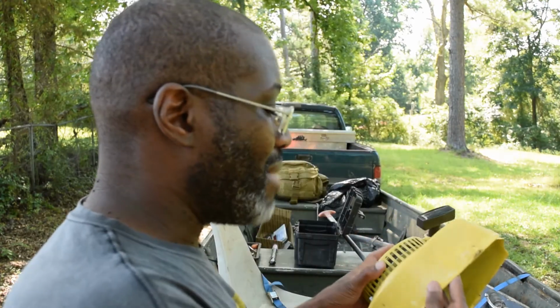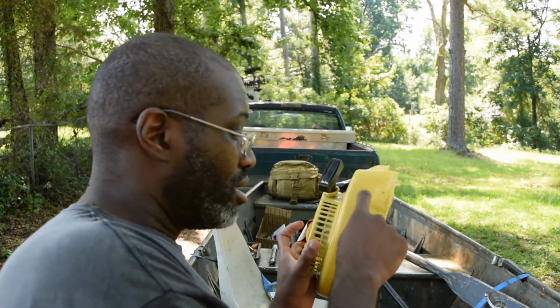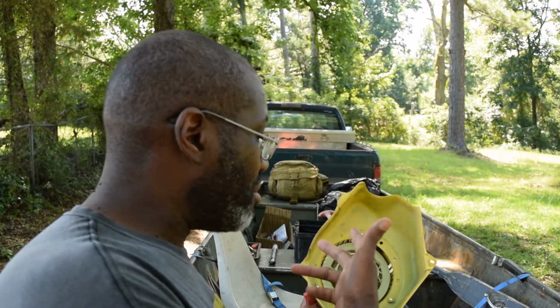If you're one of these guys you got your Predator and you're happy with it, your Predator 212 or your 420, and you're like, yeah, man, I really do want more gas in it. But all you're going to do is maybe stage 1 mods, which I do recommend for everybody. All it is just a free-flowing exhaust and intake, and you're not doing anything on the inside of the engine. Engine will run reliably for years and years that way. Your throttle linkage is going to be different because you're going to use the stock throttle linkage, but you're just going to have to find a way to mount the plate. And I would just have some options there in the class, some different sorts of mounting options. You could even mount your pump right here on this thing, right there, if you really want. Just drill some holes, tap them, put them in there.